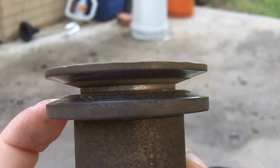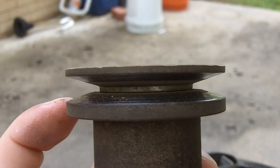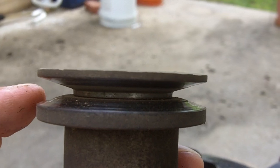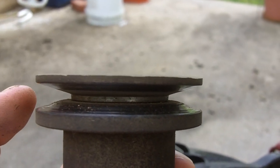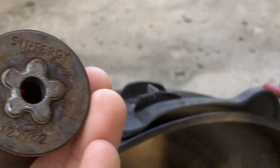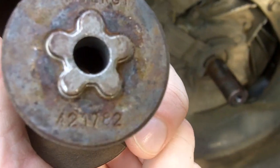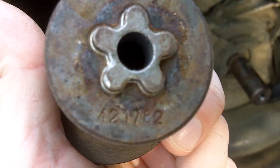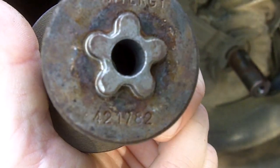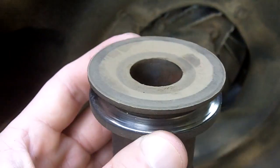Before you replace your belt, check your pulley right here on your blade adapter to make sure it's still shaped like a V — in this case it still is. If it's not, the belt won't grip well, and you'll need a new blade adapter. The part number for one of these is 421782; you can probably get these online or from Sears.